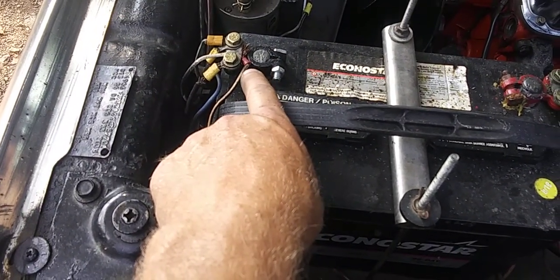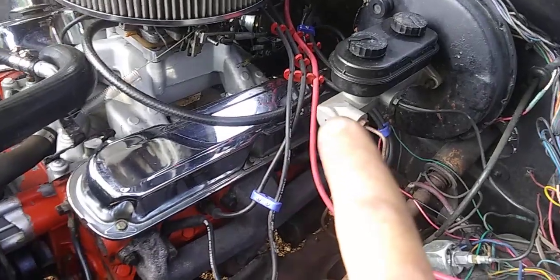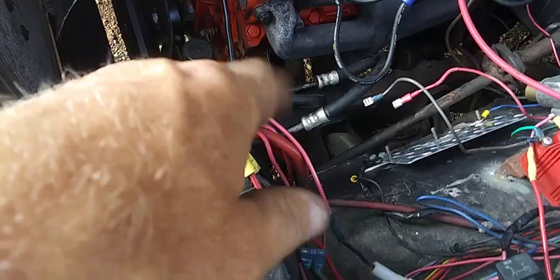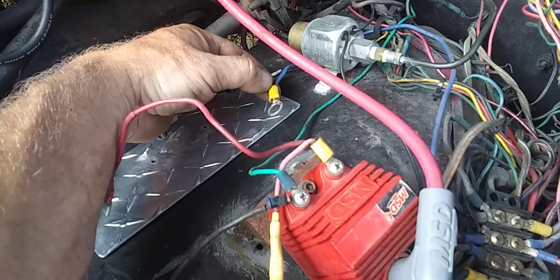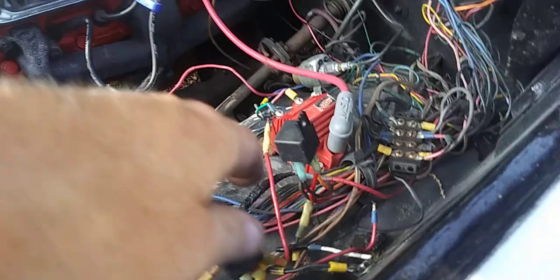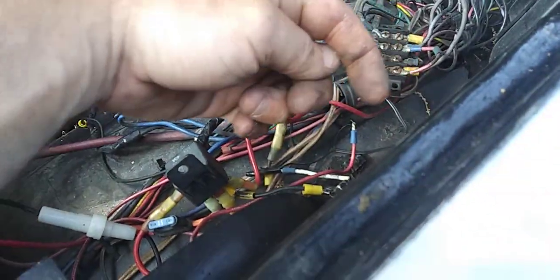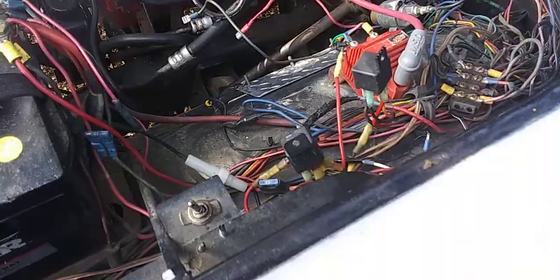This has been on the truck for weeks. I was having an issue where the ignition would randomly not start — I thought I had a ground issue at the battery, rechecked everything and it was fine. Then I realized years ago when I first did this mod I forgot to solder the connection on this connector. Make sure you solder all your crimp connector connections — guaranteed to prevent corrosion and rust, especially with rainwater splattering on everything. I'm going to make a bracket and maybe even a little sheet-metal awning to keep rainwater off the relays.